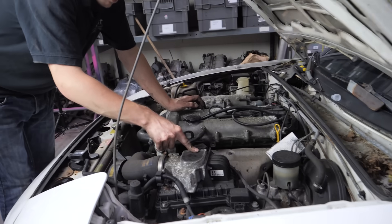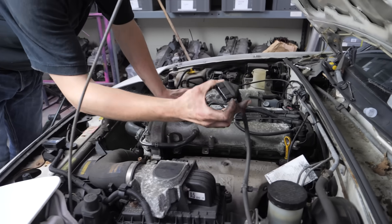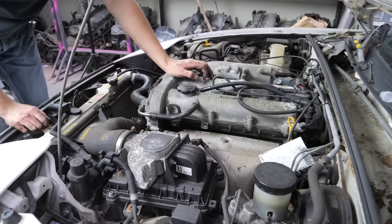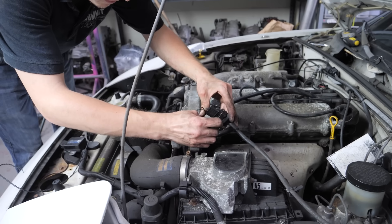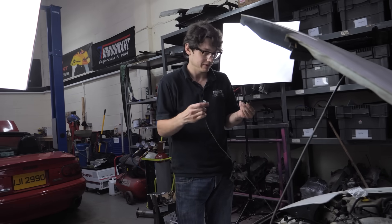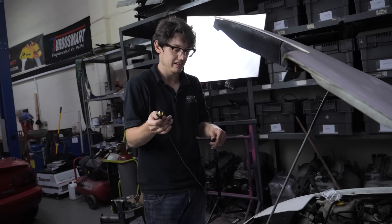Time to do something about this lump. The kit came with an adapter to plug in here to attach an IAT. That now connects the IAT — just crimped the included connector on the end of the pigtail. As soon as I plug this in, we now have an IAT.